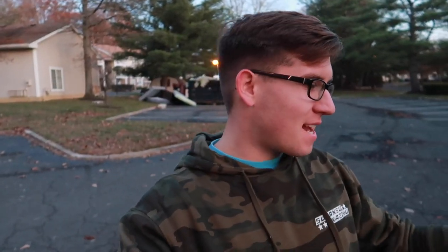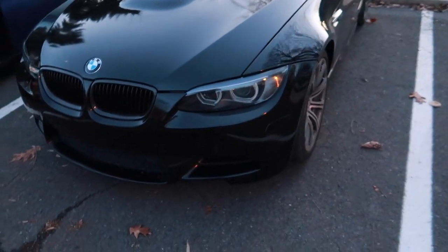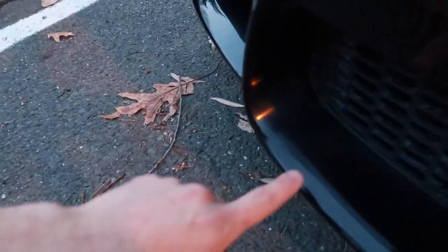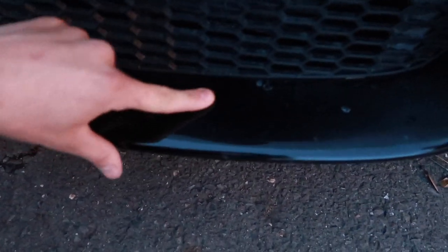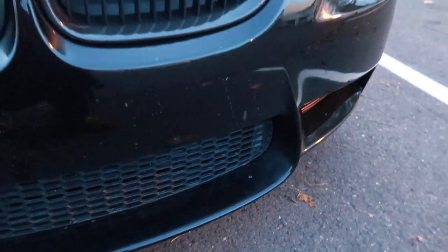Alright guys, it's a new day, and last night I did end up finishing the sanding and the buffing of my front bumper. It did come out really good, better than it was before, but it does have a lot of issues and that's my fault. In a couple areas I kind of messed up the clear coat — I chipped the clear there, and taking this toe hook cover out I chipped the paint completely there, so that's down to the old silver color of the bumper. There's a lot of areas where I didn't do a great job buffing. I did a great job sanding but my buffer just couldn't get into all the areas. This is just salt — they salted the roads last night because of the snow — but you can see it's hazy. My buffer couldn't fit in a lot of areas, so I need to figure out what to do on that aspect.